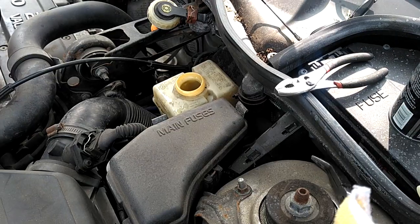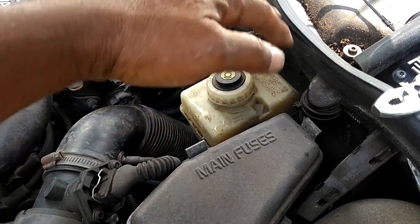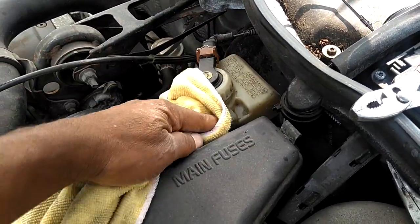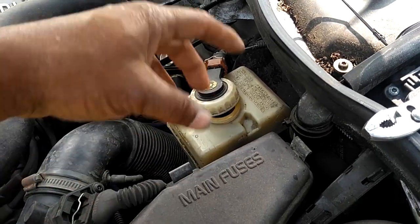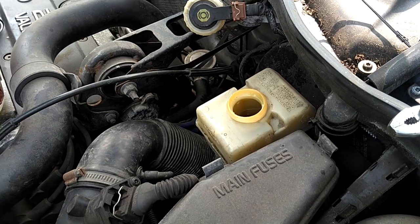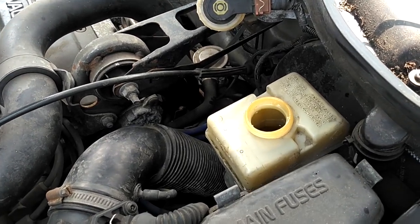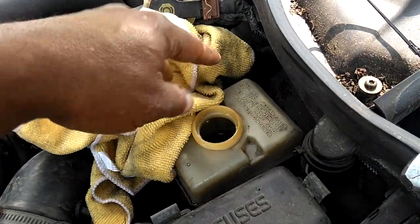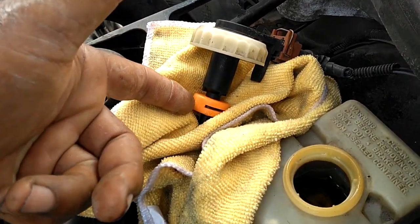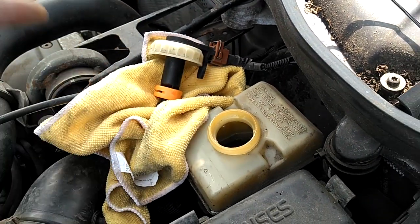Let's get started. You want to protect your brake fluid system from any dirt contamination. First, clean off the reservoir top — spray it down with brake parts cleaner so no dirt falls in when you open the reservoir. Protect your painted and other surfaces from brake fluid, as brake fluid is corrosive and eats through paint. Take the lid out, put a rag under it. The float sensor inside needs to move freely up and down so you get a warning light if your fluid gets low.